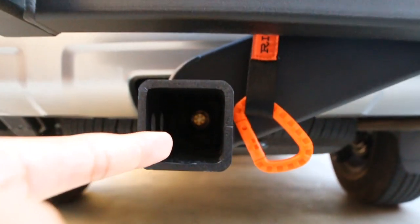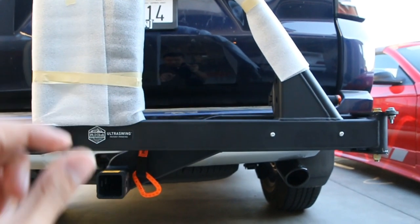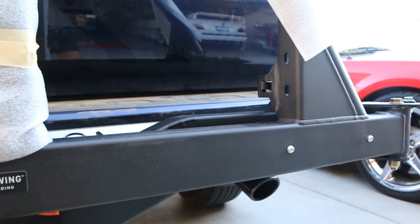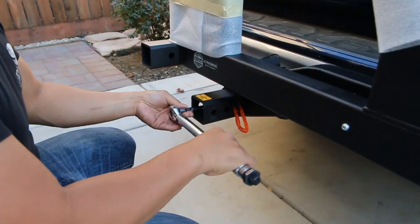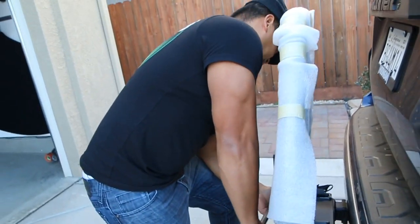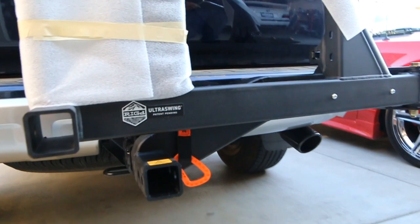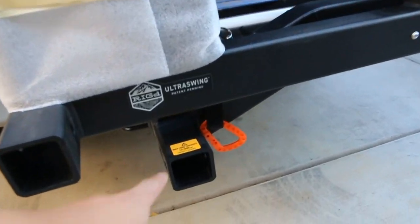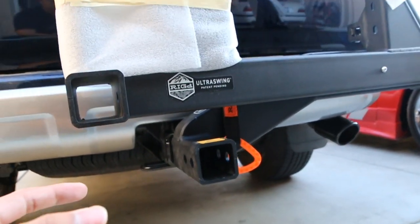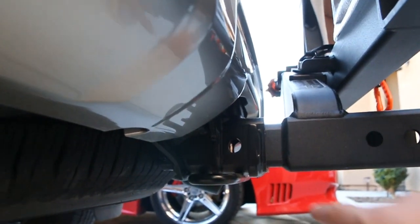Now that we're all greased up, just going to line up that wedge and toss it into here. Now we're going to stick our socket in there again and tighten it down to 100 foot-pounds. That way it levels out the ultra swing because it'll expand that wedge and level out our arm. As I'm tightening this wedge you can see the ultra swing starts to level out. Unfortunately our Harbor Freight torque wrench only goes up to 80 foot-pounds, but we're just going to use 80 pounds plus my dad's gigantic arms — that should be tight enough. The reason you want to do it up to 100 foot-pounds is because the ultra swing has a towing capacity of 10,000 pounds, meaning you could still use this adapter to tow a trailer with the ultra swing on there.